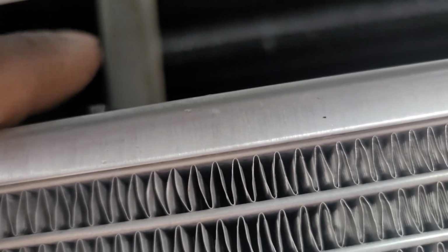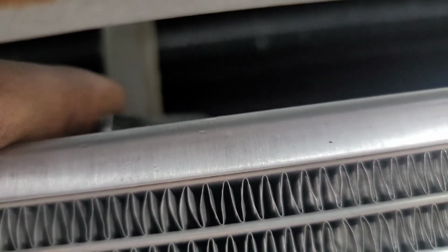And before you put it on, if you notice also too, there's that piece right there. I just bend it out the way because it didn't want to hit the latch assembly. So I just bend that out the way. And then the top of the heat exchanger, you want to put that in first before you hang the heat exchanger. So have that set up first, and that'll make life a lot easier.